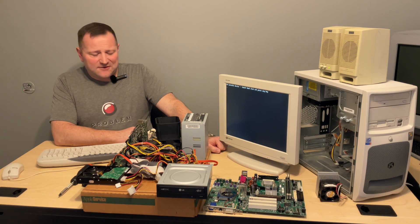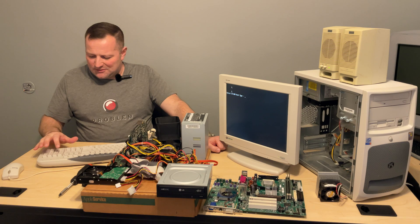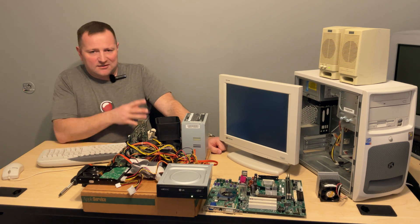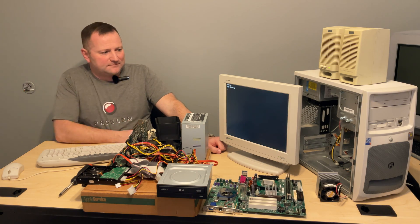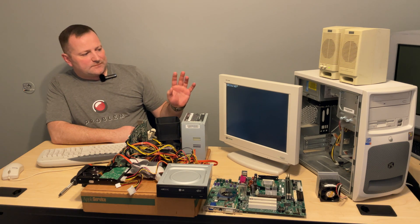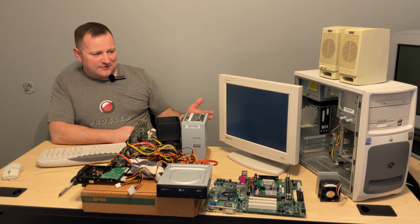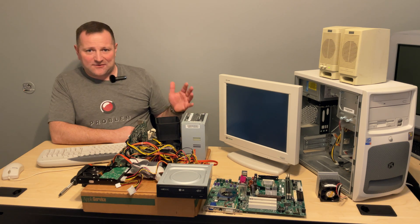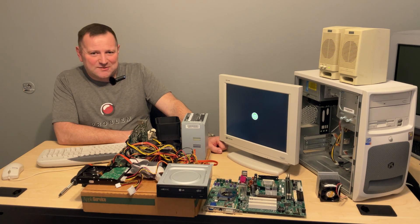There are fixes for it, but I didn't feel like digging that deep. I did find a fix myself — going back to the CD-ROM boot, hitting number one to boot to the install drive, and then from there you boot local drive, and then GRUB loads. The great thing about that is I was able to get back on my feet and start tinkering with the system, figuring out what I can make in this video. The bad thing is you can't do as much as I hoped you could with this system on a new OS.